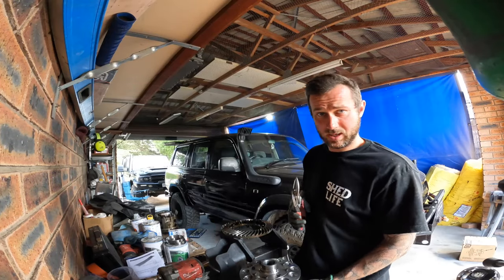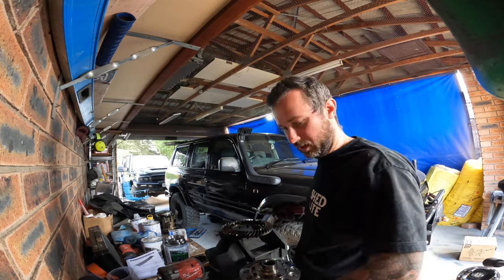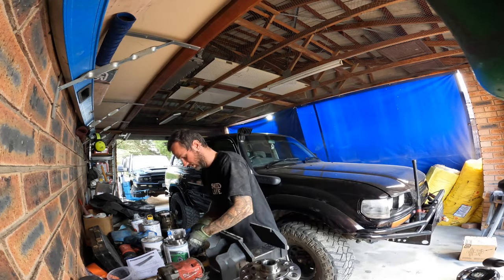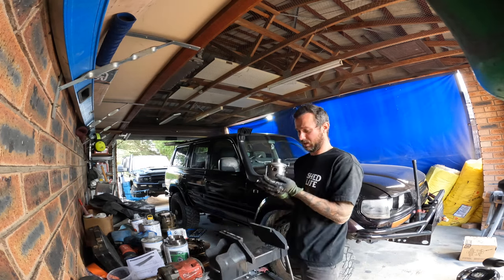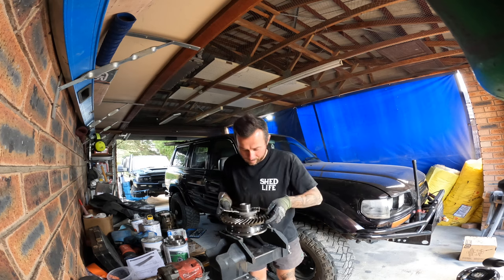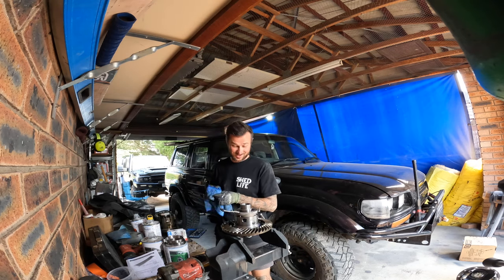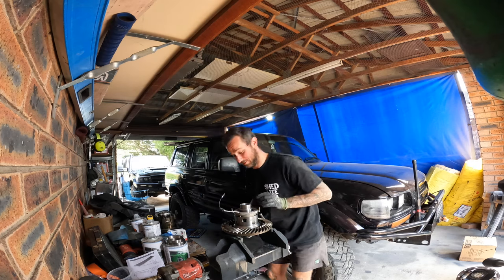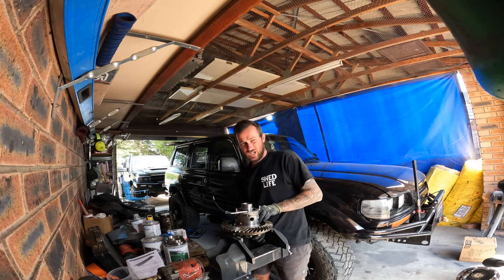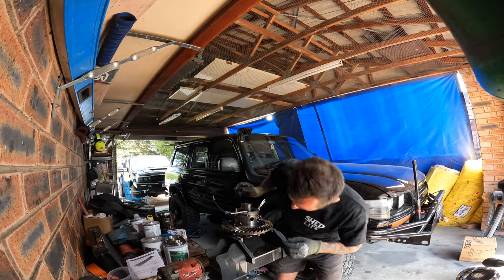I've just gone and turned the oven on and put my carrier bearings in it. Whilst we do that, we're going to softly bolt this crown wheel up to the new locker so it's ready for when we get to the bearing. We're going to flip this, open it up a little bit more, drop it on the crown wheel. I don't know exactly how long to put the bearings in the oven for — I'm going to go with about 10-15 minutes on max to expand it as big as possible. I'm going to put my welding gloves on because they're going to be a little toasty.